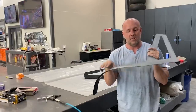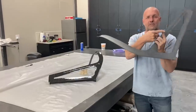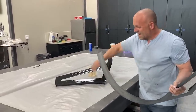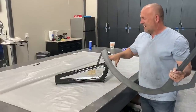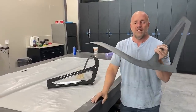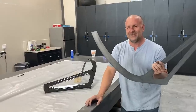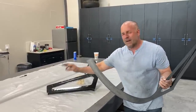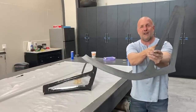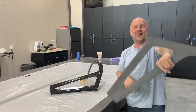So I sanded it, got it really smooth. There are still going to be little pinholes all over because carbon fiber is a weave, and I want to fill that. This is just me taking clear coat, dipping it, and scrubbing it into the part — it's all bubbly and runny, but if you just scrub it in, let it sit overnight, come back, wet sand, polish it all out, then that fills the little pinholes. Then get the gun and spray a nice clear over top of it. Sometimes you get lucky first pass, usually not, and you'll end up dabbing a couple little pinholes the second round, sanding them out, then clearing it. Step one: make a part, sand it. Step two: baste it, rub it all in with clear coat. Step three: sand, paint again. Then we'll install it.